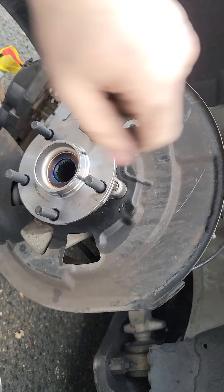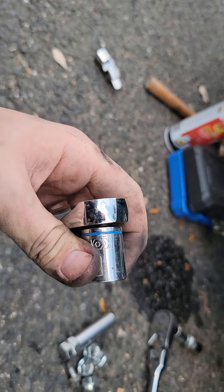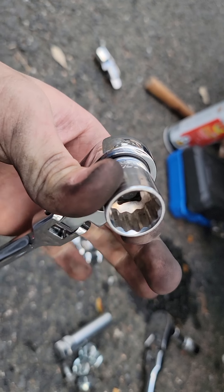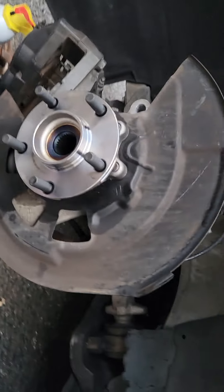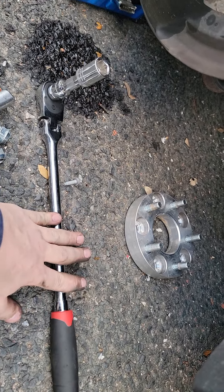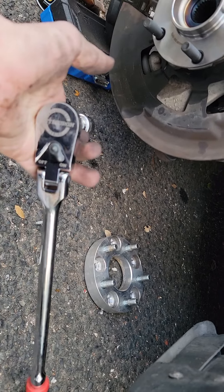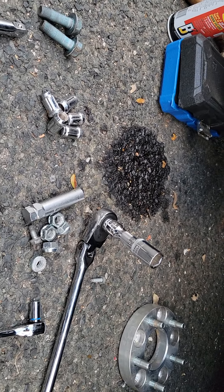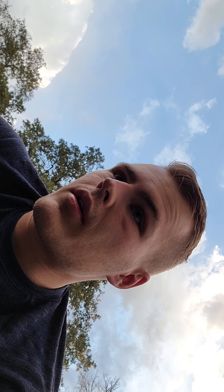I just got this all tightened down and it looks good. If you tap it you should hear a nice tone with no rattling. The tools I used: for the bottom bolts, a three-eighths-inch flex-head ratchet with a stubby 17-millimeter — those bottom ones are hard to get to with any long extension, so it's got to be small. For the top two I used my half-inch Pittsburgh ratchet with a two-inch extension and a flex-head 17-millimeter. That was the only way I could get to both of those because they're pretty hard to reach and require specific tools.